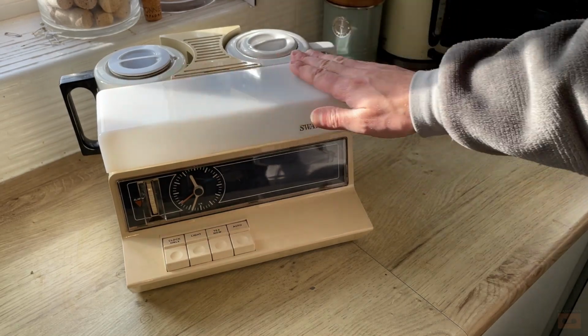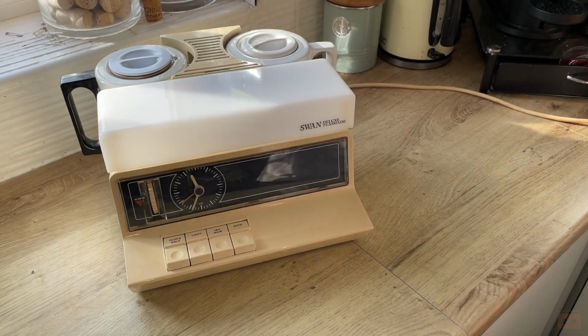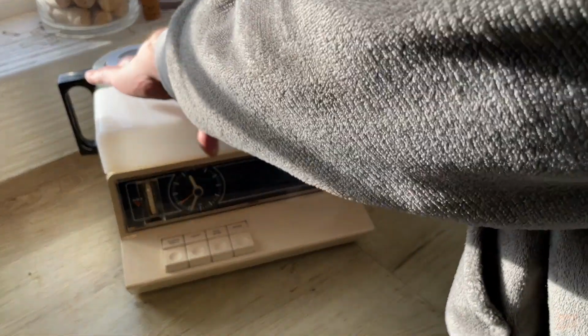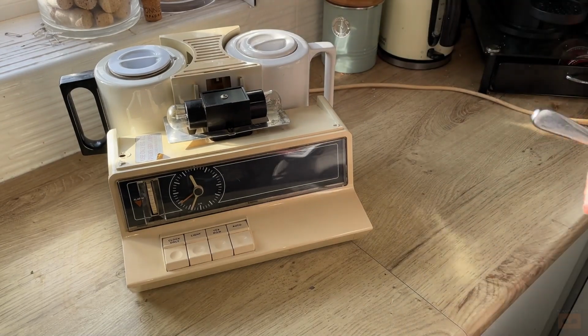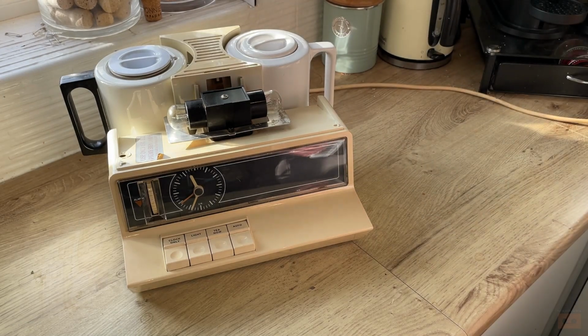And then we have our light up here, as I've already shown you. Now to change the light bulbs if needed, just get something thin like a knife, put it down the hole and push that way. It releases a small metal hinge, and as you can see inside, there are two small bayonet fit bulbs that go inside there to illuminate it.